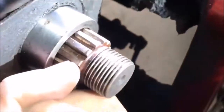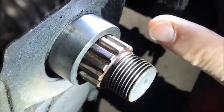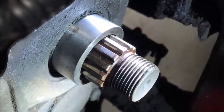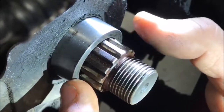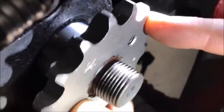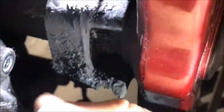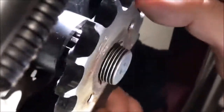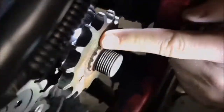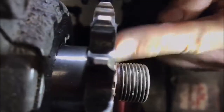There was damage back here on the splines. The sprocket needs to go all the way back against the spacer so when you torque it, it takes up that whole gap. We'll have to overcome some damage to get the sprocket on, but it's going to make it tight. The last brand was JT, so our replacement JT is the same one. Notice how proud the shaft end sits.